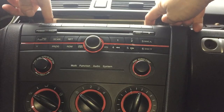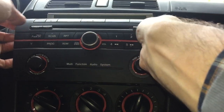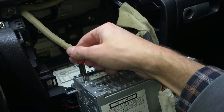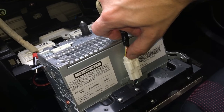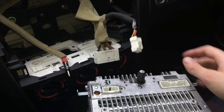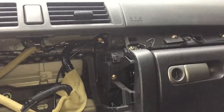Getting the radio out is really easy — just pull it towards you, and then tilt it upwards a little bit to get the LCD display out with it, because the display is attached to the radio. Then we have three connectors: the AM/FM antenna, the harness for the LCD display, and the main harness for the radio. There are little plastic tabs on the connectors that you have to press down to detach the harness.